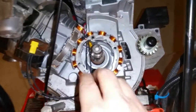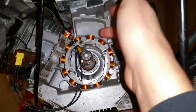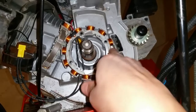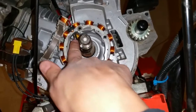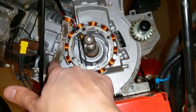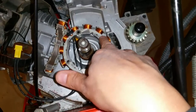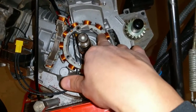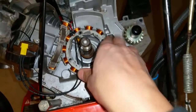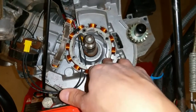So this is the stator install. These holes are actually offset — these two are closer together, and from here to here they're farther away, so it really only goes two ways. The wires run through in here. I've got the 79790 off to the side. It does fit, but I need to find the right bolts to tap these holes. After I do that, I can put the flywheel back on and have 10 amps at my disposal.